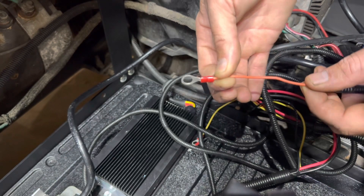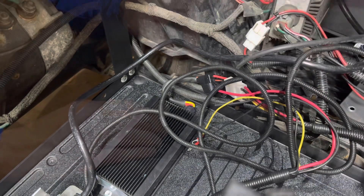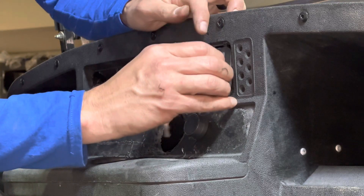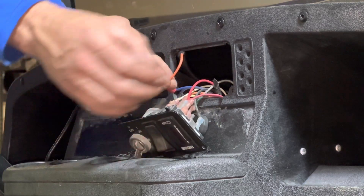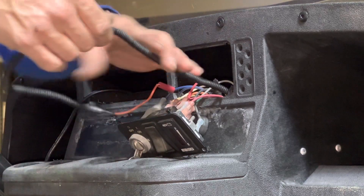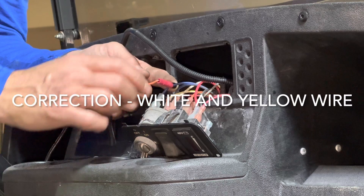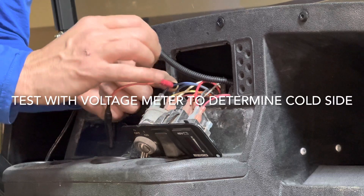We are going to run the long orange wire up to the dash with the voltage meter wiring harness. I clipped the eyelet off and put a posi-tap on it, tapping it to the cold side of the key switch. In this model TXT you have little plastic tabs — push in the center and they will pop out so you can remove that panel. Pull the long orange wire through, pulling all your slack, and hide it in the dash. We posi-tapped it to the blue wire out of the back of the key switch, which will activate the 12-volt reducer when the key switch is on.